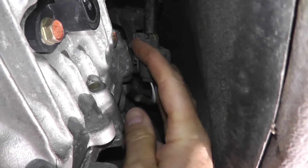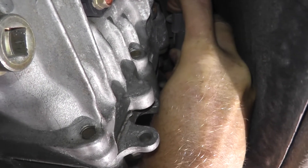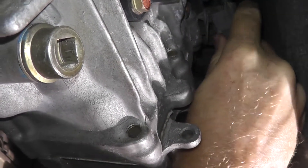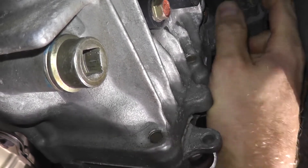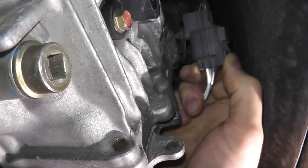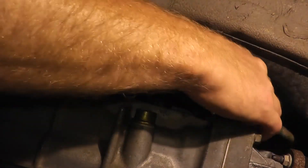It's a little hard under here, but remove it from the bracket. Watch my index finger — push in and there we go. This is important because you don't want to crack these. You're pressing this in and then pulling out. Right here is where the sensor is connected. Press down on the harness connector, then remove — pull from the body, not from the wiring.